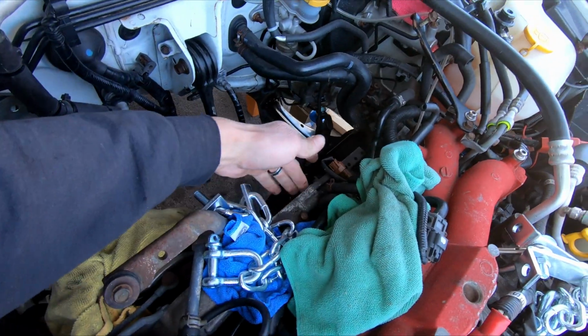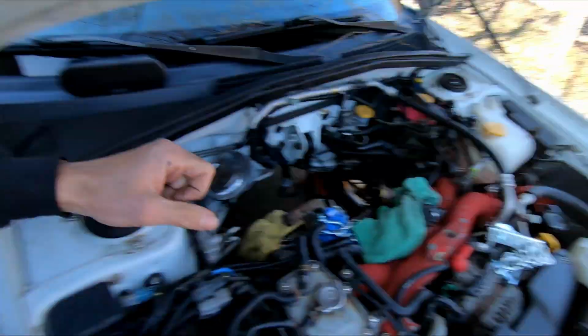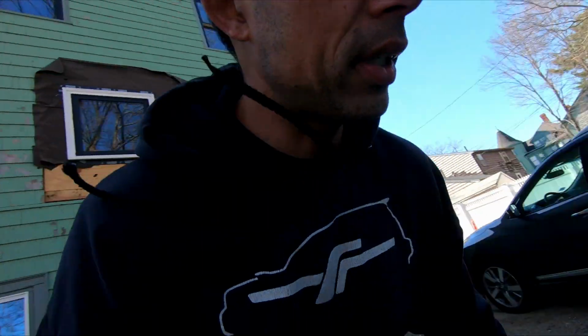Speaking of getting the transmission out, the separation of the transmission from the engine. Not only getting those bolts out, the bolts are actually fine, and those guide pins were corroded, but with some penetrating oil, they seemed like they were probably all right. But separating those two, and maybe it was the pins holding them on, was a pain. Actually, we can go look at that right now. What we did, I just used a screwdriver and a little wedge, and I just hammered it in between the two, and did the best I could without damaging anything.